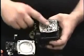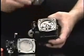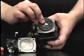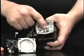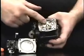When fuel leaves the regulator chamber through this hole here, which leads to the high and low speed jets, then as the fuel drops, the regulator diaphragm will drop, pushing on the control arm, pulling the needle out of the seat, and allowing fuel to enter the regulator chamber again.